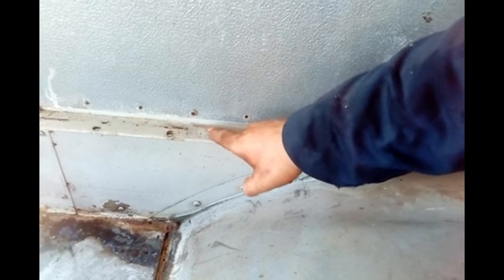The whole reason I'm pulling these walls off is to replace the insulation. The fiberglass underneath is very poor insulation, and a lot of times when water gets in there it gets moldy, and I don't want mold growing in my walls. But if there's no water in the walls and it's not moldy, all this was a waste of time. I could just slap dense foam insulation right on top of these walls up to the lip, and that would be sufficient insulation on the walls of this bus.